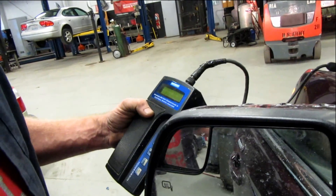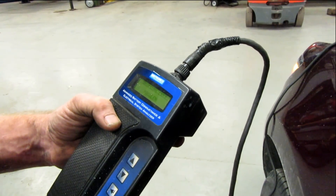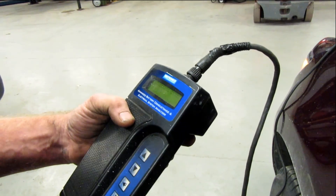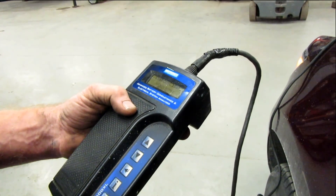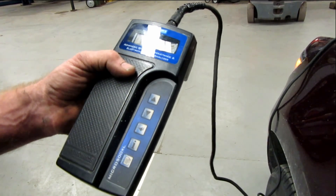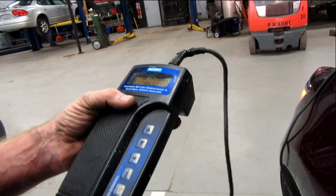What's that saying? Normal charging voltage. Excess ripple detected on your diodes at your voltage regulator — voltage regulator is bad then. Yep. So that was when you had the loads on. It wouldn't detect the rev going up. You saw how much faster it was going the second time than it was the first — it wouldn't even go up to the test line.